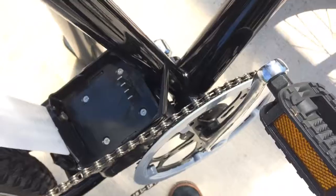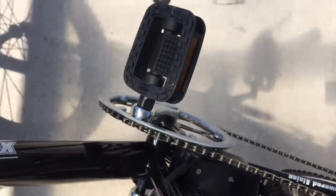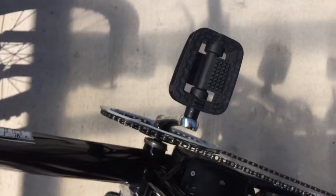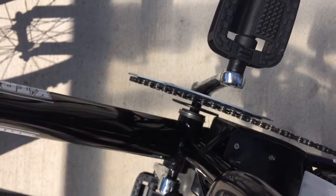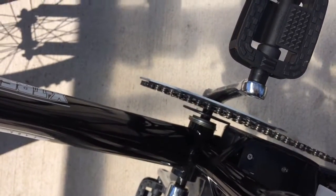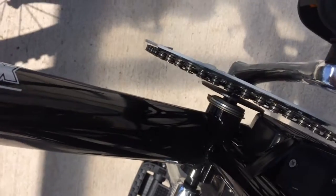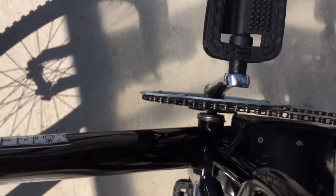The second one — you cannot see it right now, but the front chain ring is bent and I cannot show you because I only have two hands. But believe me, it's bent. Right after unpacking and assembling the bike, I tried to ride it and unsuccessfully — every two meters the chain came off the chain ring. I bent it back a little by hand and now I can ride, but the chain came off once yesterday evening during six miles.